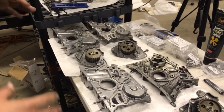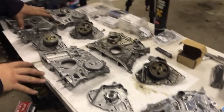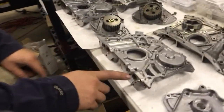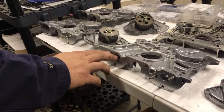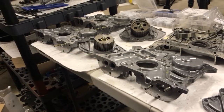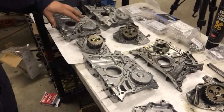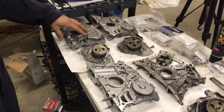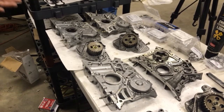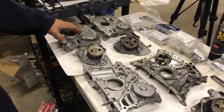As far as I know, these three pumps can all be interchanged — the pickup is in the same location, and the feed and return for the oil filter are all in the same locations. The only issue with using the Alteza 3S pump is that it kind of hits the block, so you might need to do some clearancing if you want the extra oil flow or whatever advantages that pump would provide.